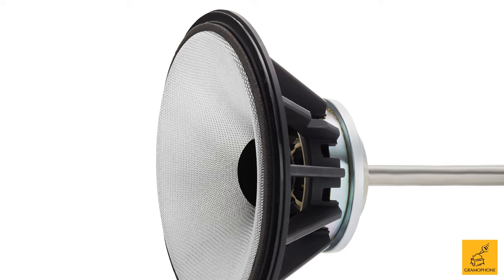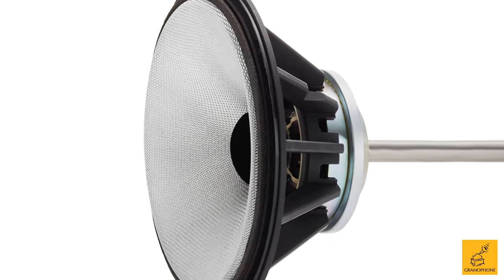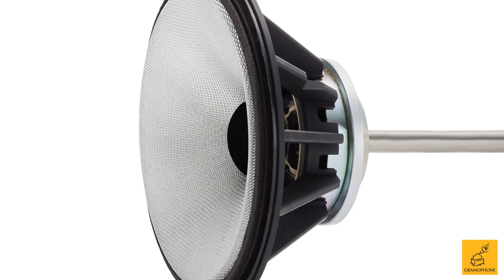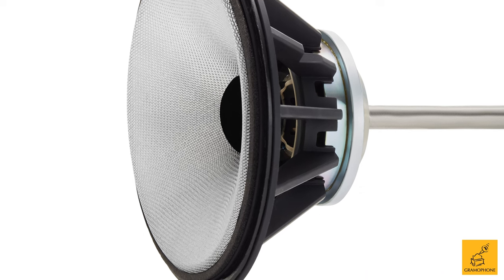There's basically no noticeable surround, because the surround material is actually tucked behind the cone of the mid-range to minimize its involvement with the sound field — cleaner presentation, better expansion.